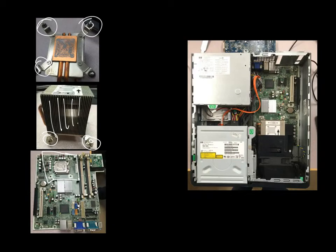One thing to consider before you put it in is make sure that the arrow right here that is on top of the heatsink is facing away from the fan, which is right here, because the air is actually supposed to travel that way through the heatsink when the heat gets transferred through it from the processor. So simply enough, you're just going to put it on top of the processor here where those 4 screw holes are. So here's the processor.